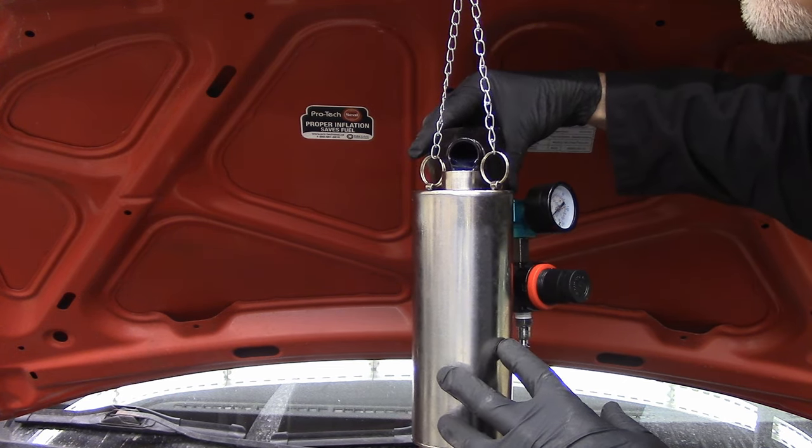If you're putting this on a vehicle that has a return system, you don't want to put this higher than the return pressure to the tank. So if the fuel pressure regulator is set to be like 50 PSI, you want to put in 45 PSI so you don't just send this to the gas tank. If the line pressure is 63, run like 58, about 5 pounds lower, whatever it'll run on, because we want the engine to burn this.